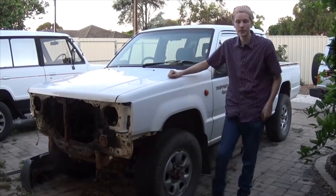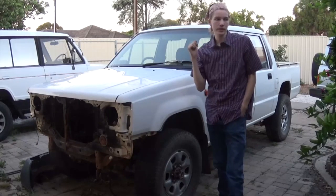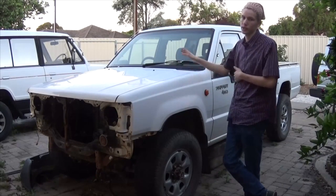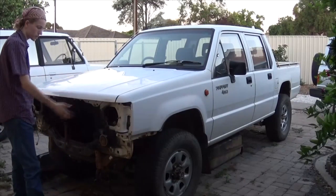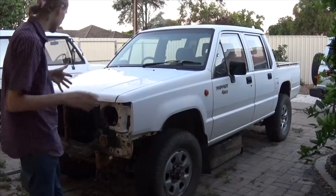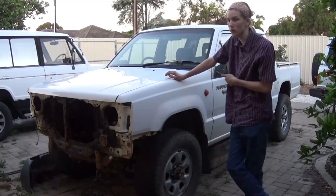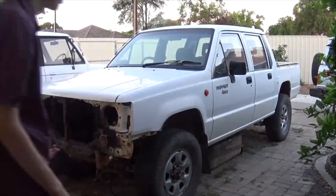It has different seats in it now at the front, but they actually work really well in this car because they lean back more. In the other car they couldn't lean back because you had to slide the chair forward. I have to get some bolts to re-secure those seats, put a piece back on, and put the lights back on here. I need new tyres, a differential for the four-wheel drive system, and a replacement rear differential because someone flogged it really hard with a V8 and it's done lots of damage to the driveline.